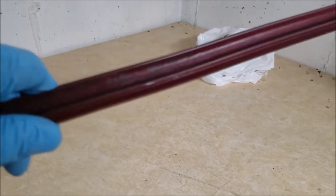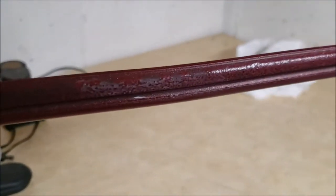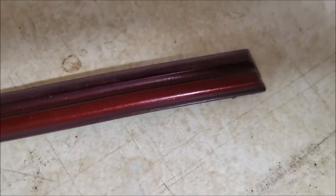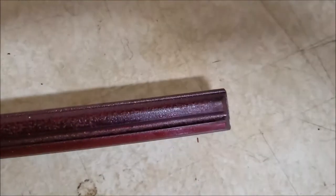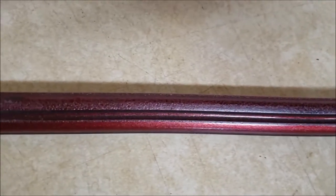The deal with this is these had a tendency to burn in the sun and fade very badly. There's a lot of burn to it. What happened is the previous owner decided that when he had a little touch-up paint done, he would just have them go ahead and paint this molding at the same time they painted the car. Not a bad idea because they were basically the same color, but the problem lies in the fact that he used a base coat clear coat on a vinyl or rubber molding.